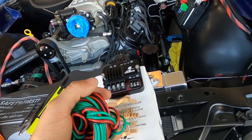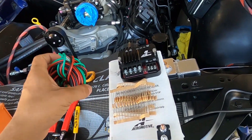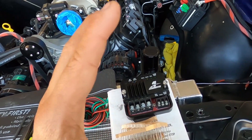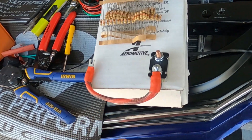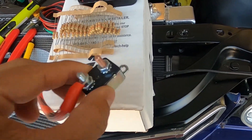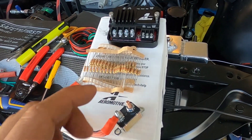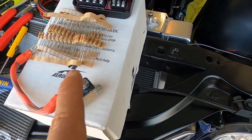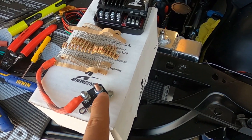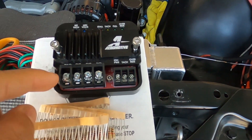Aeromotive does give you a bunch of goodies for this project — the wire you'll need to run back to their switch, the switch itself, the actual controller, a bunch of connectors, and also a little breaker relay. What we'll do is run the fuel pump wire coming off the relay from the GM harness, take the positive output and run it to this controller, then output it to the pump. It's pretty simple: fuel pump power, fuel pump ground, and a good dedicated ground from the car.